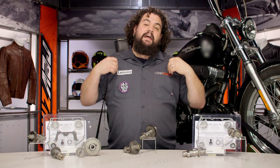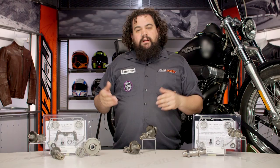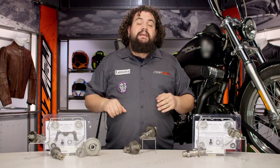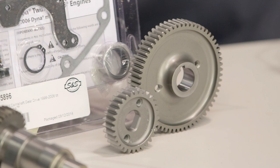When getting ready to choose a camshaft, be honest about how you ride. As much as it sounds great to say you ride around full throttle and super fast, that's not how the real world works. A fellow on a touring bike constantly loaded up with camping gear who's riding two-up often is going to need a very different camshaft profile than a fellow who's zipping around and beating the tar out of his bike on the track. They're just different riding styles and different bikes. Take all those things into account and be honest when you're assessing your needs.